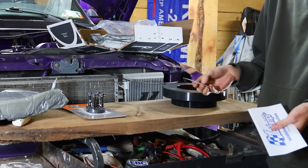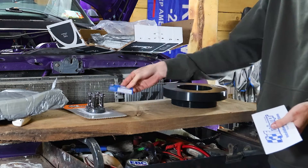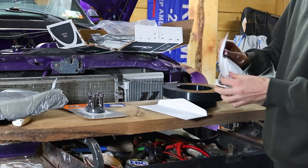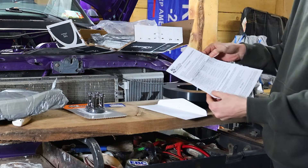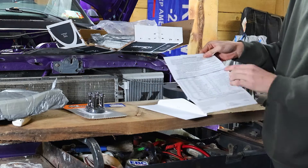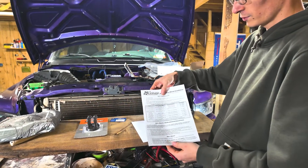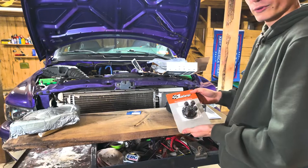Any type of power sports that require SFI-rated products, you're going to want to hold on to this — just put that in the glove box. Inside this box here, we have our installation instructions. It runs through part numbers for the different diesel applications, internally or externally balanced removal, fluid damper installation, torque specs, and on the front side — tools and procedures required. And full power kit, part number 300008.